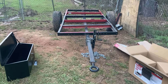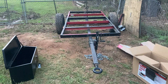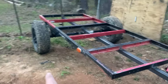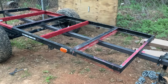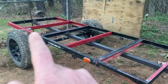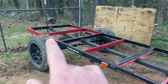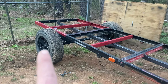If you follow any of my Jeep stuff, you've probably seen the Harbor Freight trailer I built to match the Jeep to tow camping gear. This is it now — nothing like what it used to be. The black sections are the original four-by-six trailer. This started as a four-by-eight; I cut it to four-by-six. The red pieces are all new sections I've replaced, making it ten feet total with a two-foot rear section and two four-foot sections.